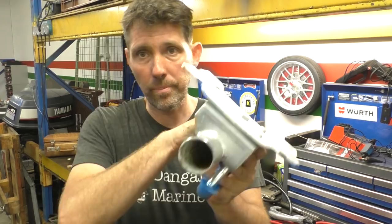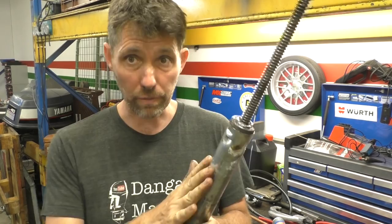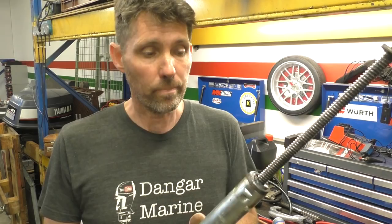Now you're not really going to see it on camera, but there's corrosion in here — and resistance on this side that stops the wheel from turning when you're maneuvering the trailer. That to be honest is a bigger problem, meaning it's something we get more frequently, because it's a large surface area of metal to have corrosion on. Because this section is slightly sealed internally — the worm drive in here — it means that this gets corroded less frequently. And even if you can't wind it up and down, you can still flip it 90 degrees, so I'm not so worried about that corrosion, but I do still think it's worth trying to solve.